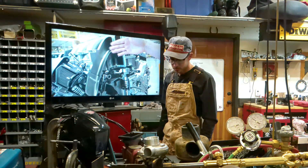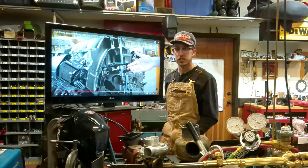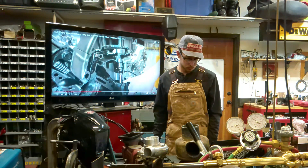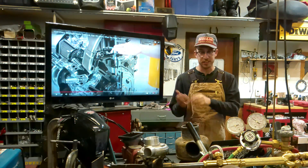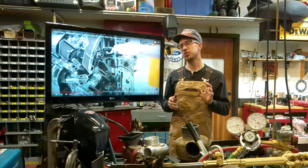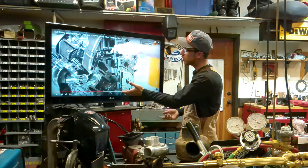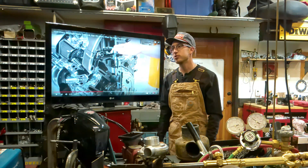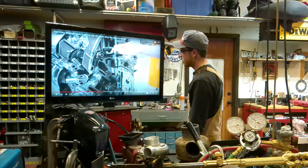Fuel comes in from the low-pressure pump at 400 kPa — that's about 55–60 PSI — then goes through the high-pressure fuel pump, which is actuated off the camshaft at the rear, ramping it up to 15 megapascals. Megapascals — this is America and that's the unit of measurement they chose. That's roughly 2,200–2,500 PSI, which is pretty high fuel pressure for a gas engine. I guarantee when they designed this engine, they used pounds per square inch internally.